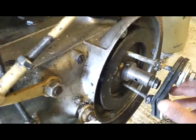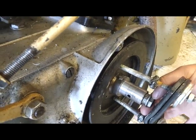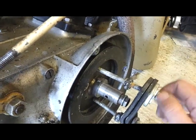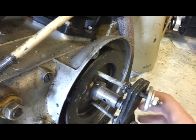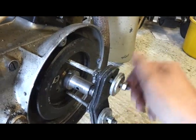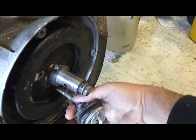I've made here a homemade flywheel puller. You release this nut, twist that round to loosen it off, and then when you do these nuts up here it will push this metal against that and pull the flywheel that way. They do snap off pretty hard. You'll probably have to make one of these because after they've been on there a few years they're tricky to get off.